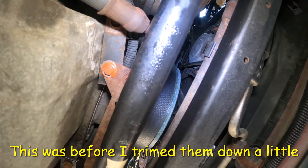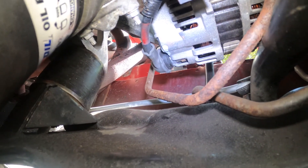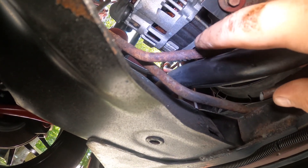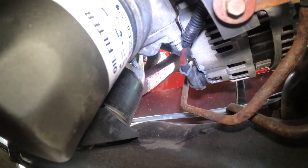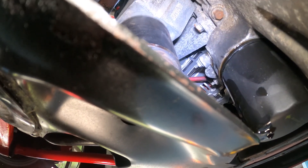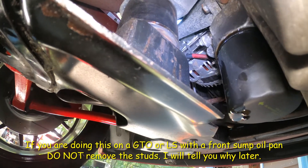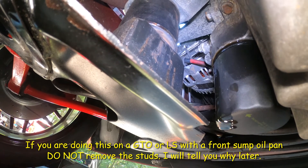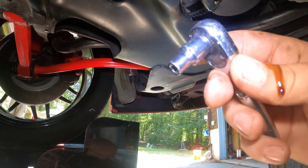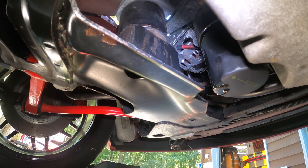We got those little brackets I made in — definitely gave us so much more room over here. Now we're going to try to get that little adapter plate off and move this back into place. On the nuts for that plate, it currently has studs from the factory, and the new one uses recessed Allens — beveled, whatever you want to call them. You're going to need an E6 inverted Torx to try to break them free — I think it actually takes an E5, but the E6 was enough to pop it. So you guys will need those.